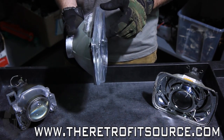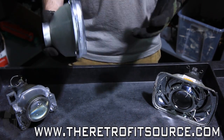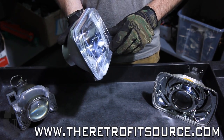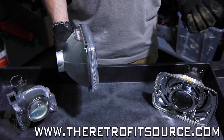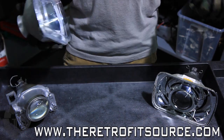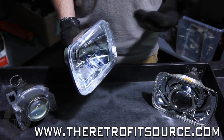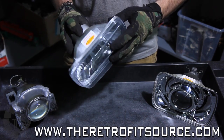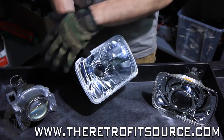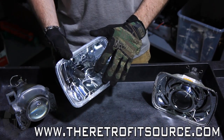As a tip, if you do insist on using a glass housing, you can actually dunk the housing into a bucket of gasoline for a couple of days, and that will eat the glue surrounding the perimeter of the headlight so it will just fall right off. That's important because you really can't heat those housings — prying on them is just going to break something. We're using the plastic housings here, pretty cheap at about 30 bucks on eBay or Amazon, and we'll go through the motions to get this Murano projector retrofitted in there.